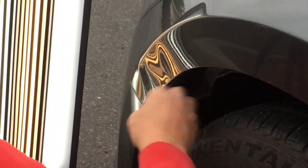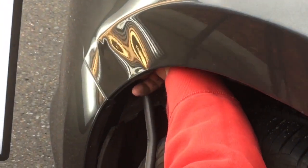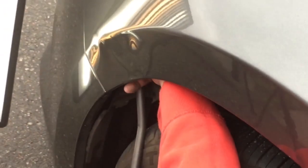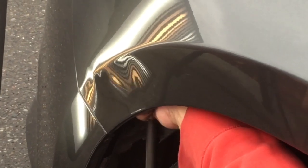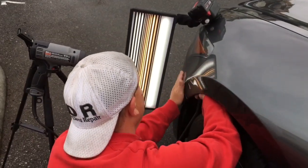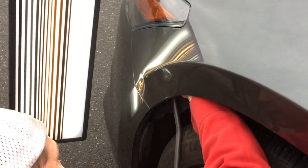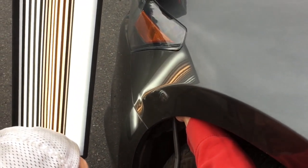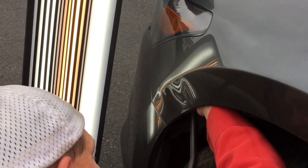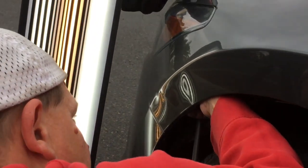I'm looking for where I am up on this ridge, feeling from the inside, pushing, and really watching that ridge. We've got it super hot — it's probably about 130 degrees. I want to make sure that I don't get the actual light or the bumper too hot because those are plastic. Then I'm gonna come in and make some of this metal come out. Baby, do it nice and slow — it's all about that patience.